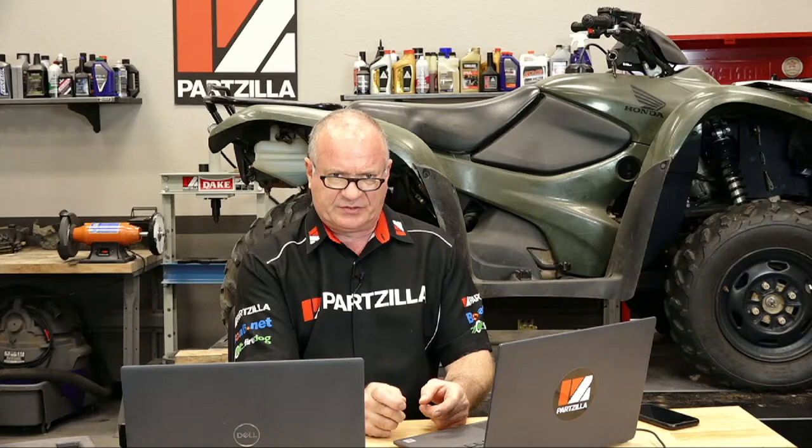The valve train, I'm betting it might be okay. When you pull it down, take out the seals, you're definitely going to want to replace the valve stem seals. But just get in there and feel it. If you put the valve in there with the spring off, and it rocks around a pretty good bit, you probably need to do something about that.